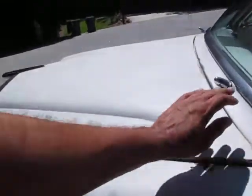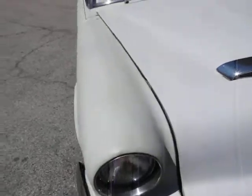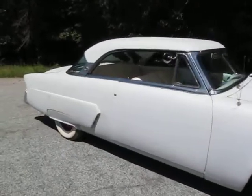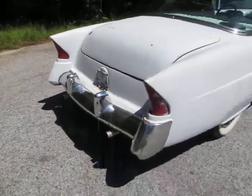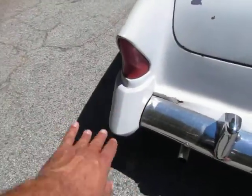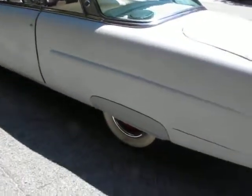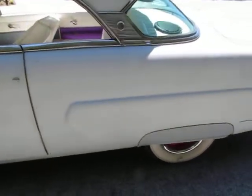Overall, this fender looks really good. Hood is in good shape, nice and straight. Got some body filler here. I couldn't say how much Bondo may or may not be in this car to be fair — when people shave door handles and you get a car like this, it's more of a project, and I would expect to find some Bondo on it. It doesn't look like a Bondo bucket; I haven't found any big globs. This has been shaved and molded around. The driver's side rear bumper is completely painted. I'm not exactly sure what people were trying to accomplish, but I love the fender skirt. The drip rails are in great shape. A couple of tiny little bubbles right here.